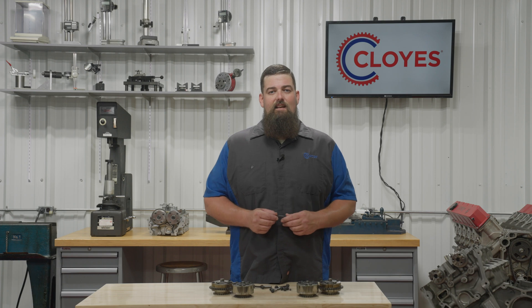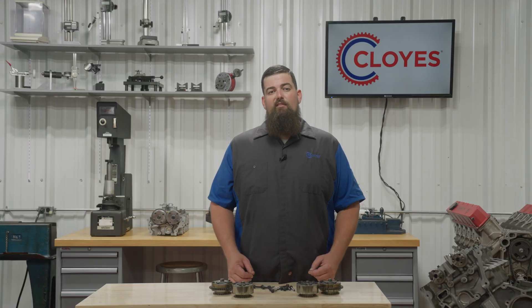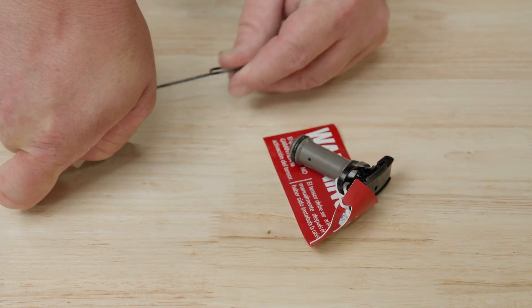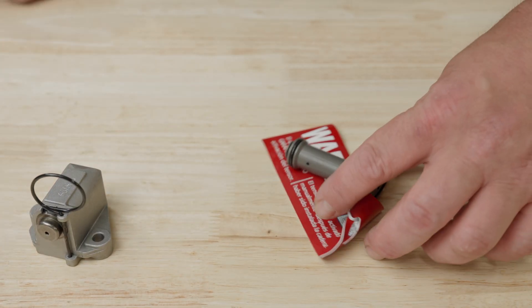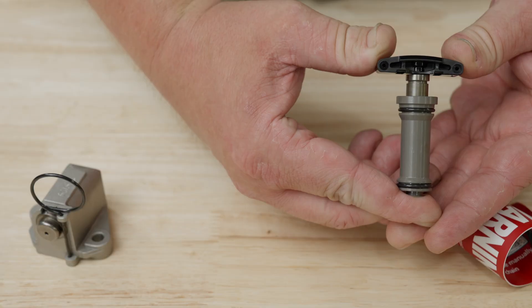Before we start the installation, there's a few things I need to discuss. The first is hardware. The camshaft phaser attachment bolts in Coyote engines are torque-to-yield bolts. They're intended for one-time use only, so you should always source new bolts before you start this job. At the time of filming, Cloyes does not offer the phasers or the bolts, but check our parts finder to see if they're available when you're ordering parts. The primary tensioners are activated simply by pulling the activation pin and can be easily deactivated by compressing the piston and reinserting the pin. The use of a vise can be helpful. The secondary tensioners, however, have a unique activation procedure and cannot be deactivated once activated. The tensioners come with a compression limiting clip, which prevents premature activation. Once the tensioners are installed and the phasers and secondary chains are in place, you must make sure to compress and release the tensioners to properly activate. Failure to manually activate the secondary tensioners can lead to catastrophic engine failure once the secondary chains wear over time. Do not forget this step.